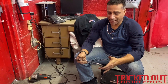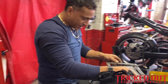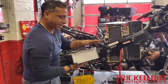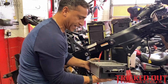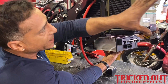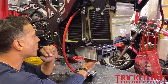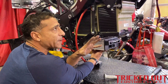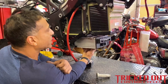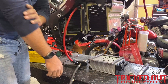Just finished mocking up the final piece of the assembly for the control unit. I changed the original idea — I had the control unit mounting in the front, but I want to switch it. I want to keep the center of mass of the bike directly under the rider, pretty much uniform to where the motor would be. I was also a little unsure about the clearance between the front wheel once the suspension collapses — we were very close, a little under specs of where the radiator would be. This looks good; we should have all the clearance we need. We'll weld that up in a little bit, then I'm going to start on the wiring harness.